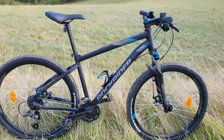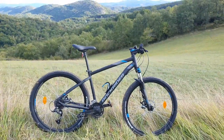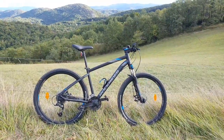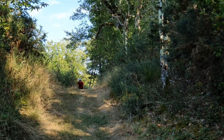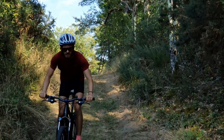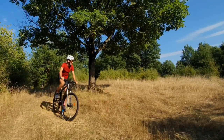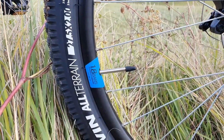The bike is pretty heavy and we actually put slime — the stuff that you put in the tires — because we were getting punctures in the first week of ownership, and that's kind of a complaint. I would definitely recommend putting some puncture resistant tires on, or trying inner tubes with the slime auto-repair stuff inside. It improved longevity and I haven't had punctures since, but in the beginning we had two punctures, so keep that in mind.